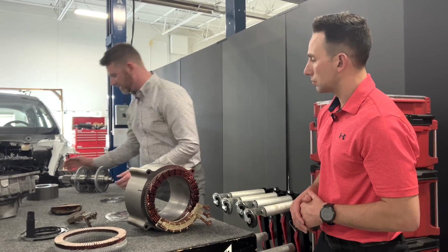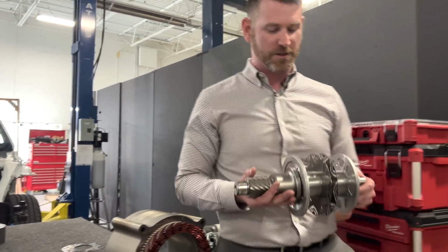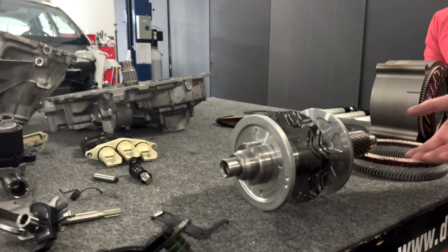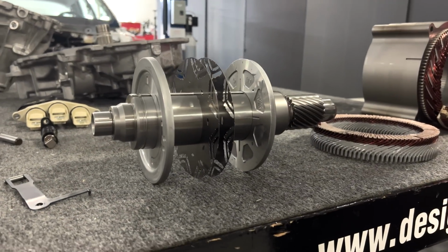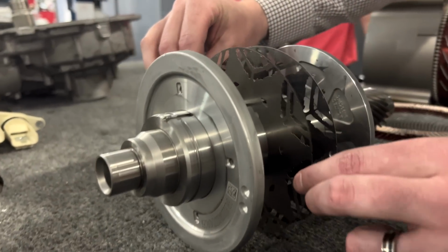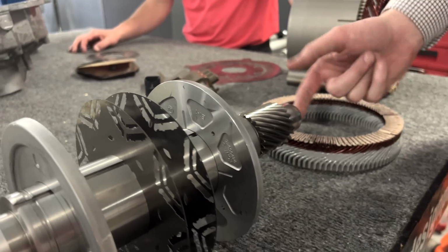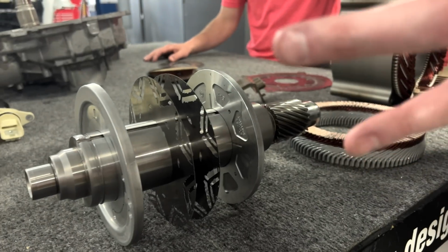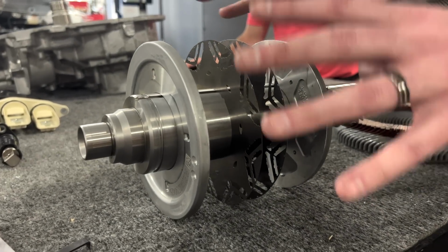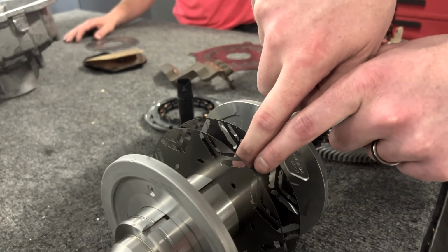Right. I guess we can talk a little bit about cooling, since there's definitely a trend here with respect to some of the things that General Motors may be concerned about. So here's kind of a decontented rotor assembly itself. And one of the things that's interesting here is you can kind of see the coolant is shot in through this side here. The rotor is spinning. Is it oil? Yeah, the oil. Oil's shot into this to cool the rotor assembly here, and then it wicks out from these passages here.